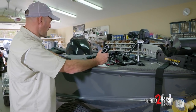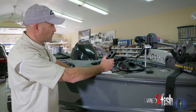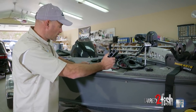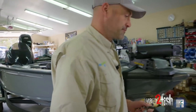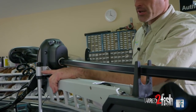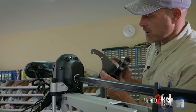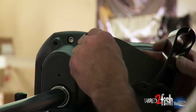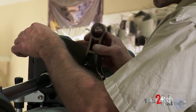Now that we have all the parts organized and sorted, we're going to go ahead and put the mounting hardware on the bottom of the trolling motor drive housing. This will only fit one way and you can simply hold it up and see how the holes align. We put the stabilizing arm on one side, and we're going to use the bottom two holes on the other side for this bracket, as well as the two holes on the top.